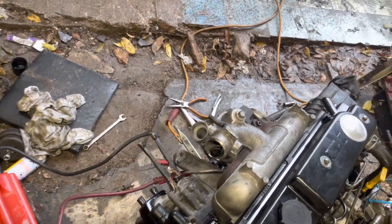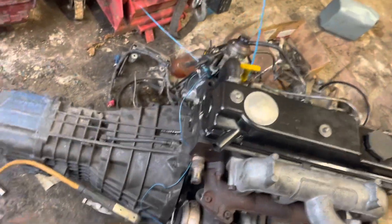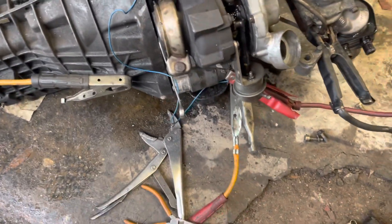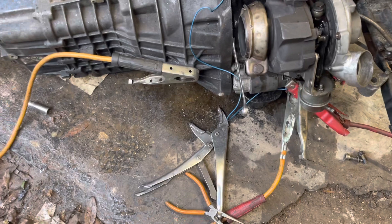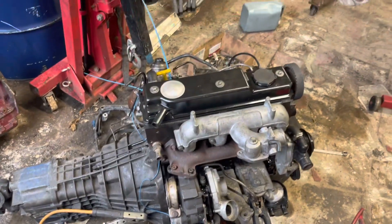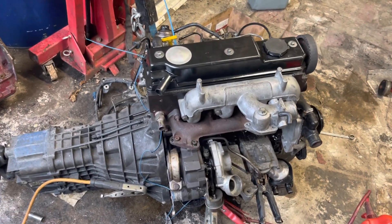The starter was staying engaged there for a second. I've had to do some funky stuff because this gearbox is from a petrol Transit and the spacing was all wrong - the starter doesn't reach and the big wing sump catches, so it's the wrong starter cobbled together just to get a tune out of it. But now we've got a tune out of it, I'll bolt it all together properly and the next time it runs it'll be in the ambulance.